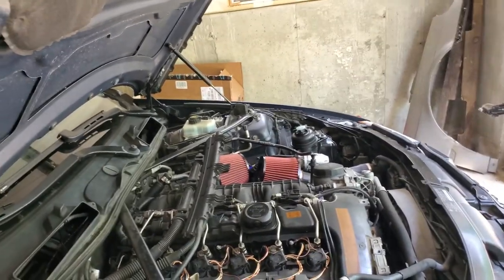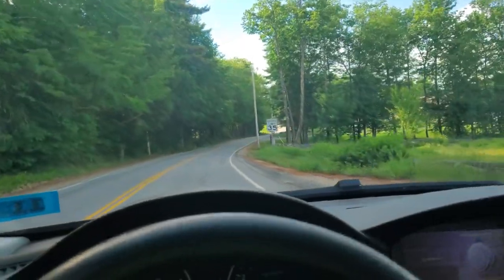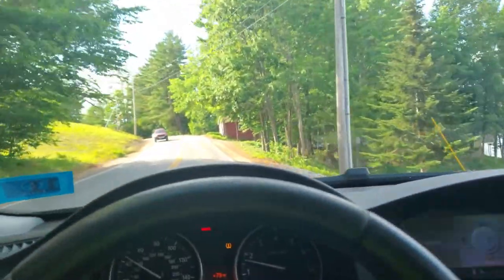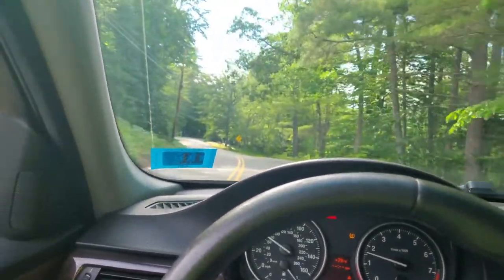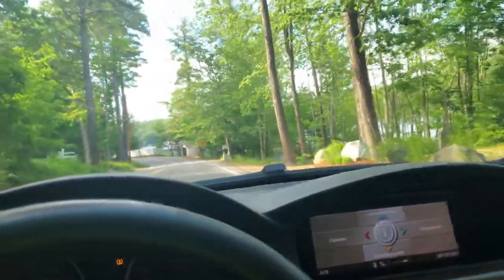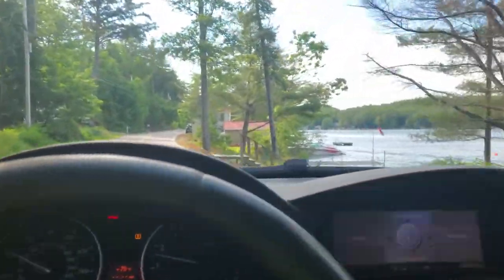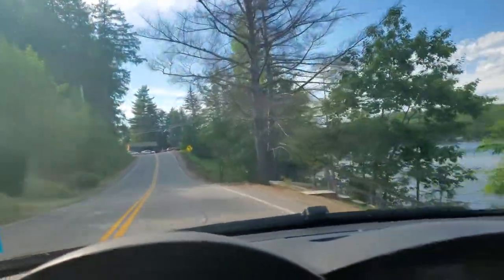Alright, turns out I turned her over and drove her in. Seems to be that it was an engine ground. So I had to jack it up and see how that ground cable underneath was doing. She lives! It was confirmed — bad ground cable. I just went to Advanced Auto and got an aftermarket one. It wasn't braided but it was surrounded by rubber coating, you know, like a regular fat wire. Put that on there, it was pretty thick too, so I was like you know what, that'll work. Then we're on the test drive road right now and she's coming along nicely. She seems to be fixed.